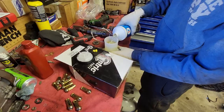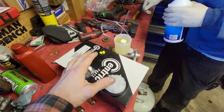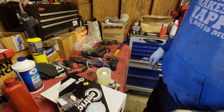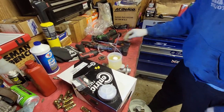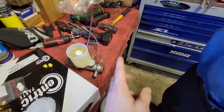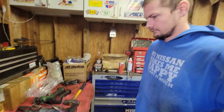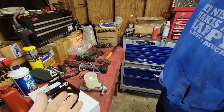The first step is to get a brake master — I'd say this is probably the best brand to get. It's a pretty standard replacement. These can be kind of pricey, but I got a deal on one from Rock Auto. One important thing to know: the bores on the back are different between years. This is a one-inch bore — I think there's a one-inch and a one-and-a-half-inch. This is a '92, so this is the right one.